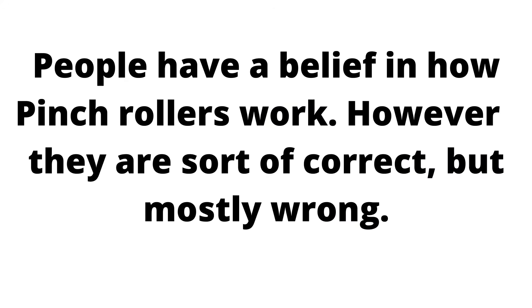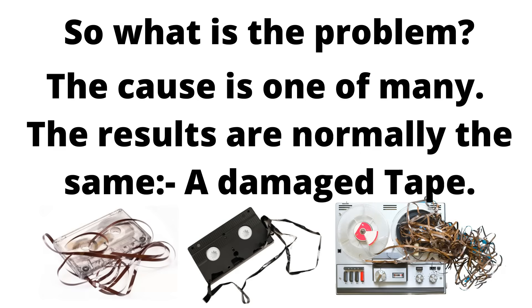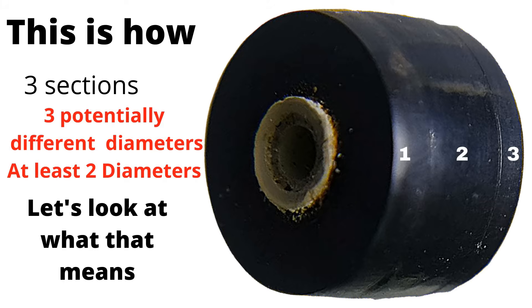So here I am being controversial again, but hear me out and you'll see where we're going with this. What the tape actually has to have happen is it has to be pressed against the capstan at a constant pressure. The crucial bit here is that the capstan and the pinch roller should not normally touch when they're under normal operation with the tape there. If they do, this is just one of the ways that things can go wrong.